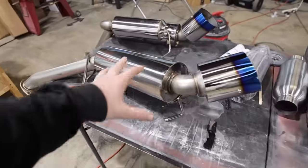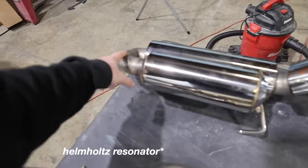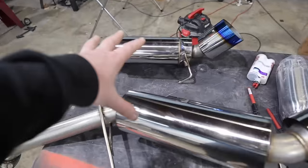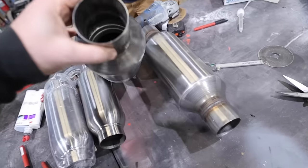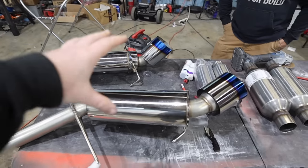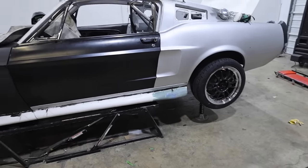It's exhaust time. Right here, we've got some exhaust that DNA Motoring sent us — this is for a 350Z, but I thought it might work well on the Mustang. Oscar called it a Helmholtz device. We have a very limited amount of space, so I bought a bunch of different stuff. Thanks to DNA Motoring. They give us their blessing to cut this up and use it in any way. So we have a muffler, a Helmholtz device, some glass pack resonators, and then these things that are pretty much worthless — there's just a piece of triangular metal inside and it might actually make stuff louder, so we're not going to run those. We're going to try and find a home for all the rest and build out our exhaust. Right now it goes catalytic converter, H-pipe, straight pipe out the back — and that's just too loud. I've got to drive this thing a thousand miles. The goal is to build a daily drivable car that I'm going to want to jump into and use all the time. If I have an insanely loud exhaust, I probably won't want to do that. Moderately loud exhaust is okay.